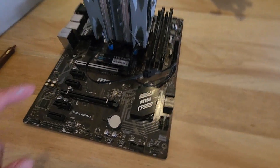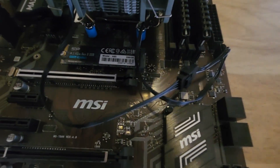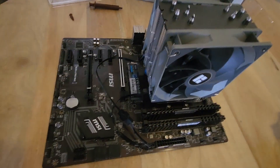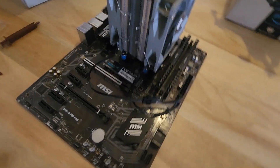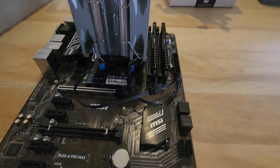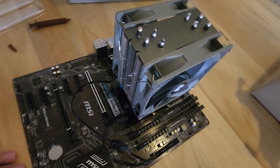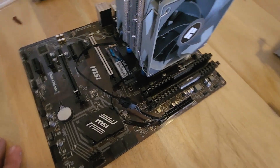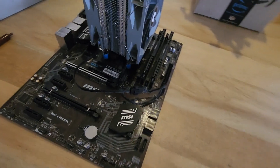I should mention I've pre-flashed HiveOS on this M.2. I won't go through how to do that — there are a million videos on it and I've even got a couple on my channel. We also need a graphics card installed temporarily, because this series of AMD doesn't come with integrated graphics, so we need display output to get into the system.